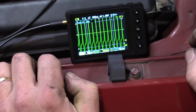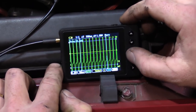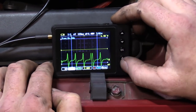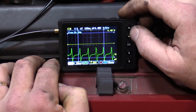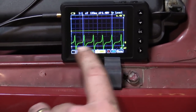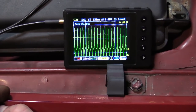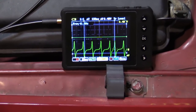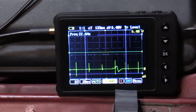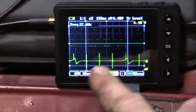Yeah, man — look at that noise. That's a better looking signal — that's my NE signal. Let me adjust the scales. You see how nice that waveform looks — hold the RPM up a little bit. That's pretty standard with this kind of waveform; frequency and amplitude will grow with RPM. That's the four-pulse signal and it looks great. Let me go back to the other one — same channel, same settings. There's your single pulse. It's not surprising the amplitude's lower, but what I don't like is the noise in between.